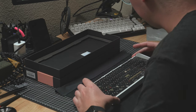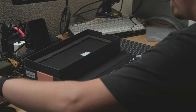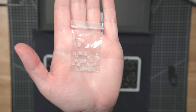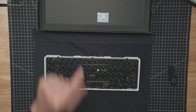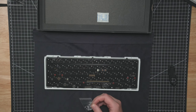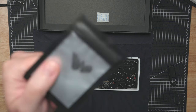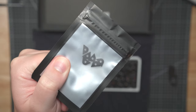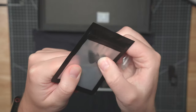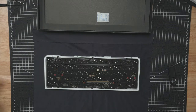I think for the sound tests on this one, I'm going to compare the top mount and the ISO top mount, but then I saw a YouTube video recently, I forget who, but I'll definitely leave the link, where they got these O-rings, they left specifications in the video description, and they actually true burger mounted this board, and said they quite liked it. So it's funny, the plate caps that come with the board put a layer of rubber between the screw and the PCB, or the plate, and the plate in the top case, which is effectively what burger mounting is, but these are very squishy compared to these. And they said these worked quite well. Again, I'll leave the link below, I'll find it for this.